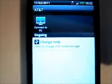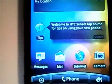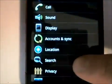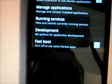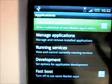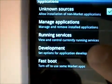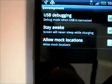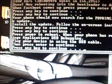The phone is on charge only, which is what we want. Go to Menu, Settings, scroll down to Applications, and we want to turn Fast Boot off. Enable Unknown Sources. Go to Development and turn on USB debugging. Then take it back out to the home screen.